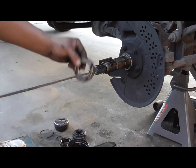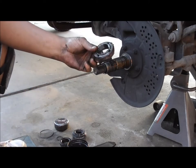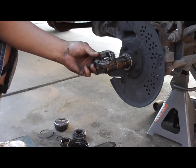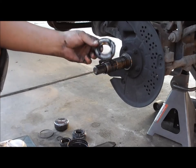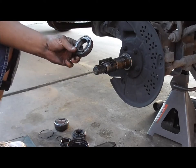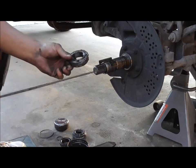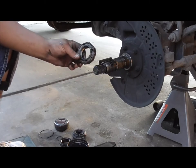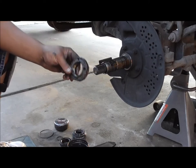This is the whole reason why I'm making the video. This is not separate pieces — not the locking ring and then a washer plate and then another locking ring. This is all one piece that ratchets along there and you've got to do it a certain way. It's 70 foot-pounds to tighten, back off 90 degrees which is a quarter of a turn, and then 20 foot-pounds.